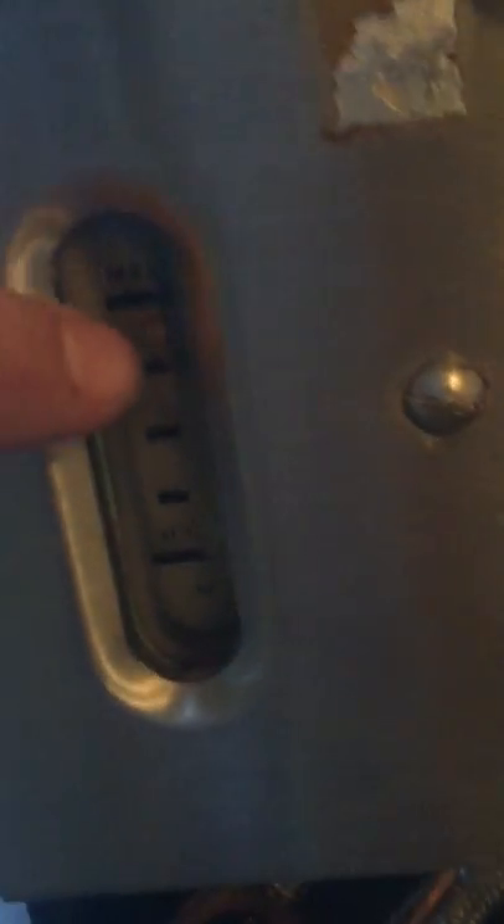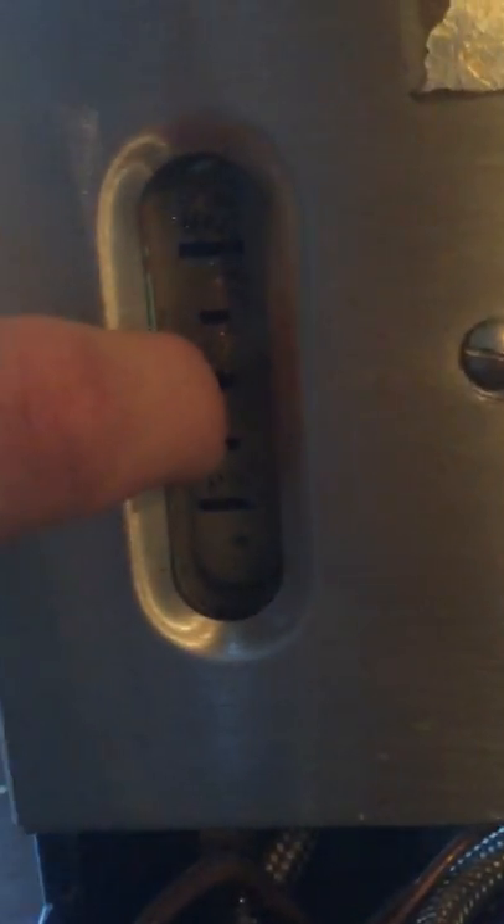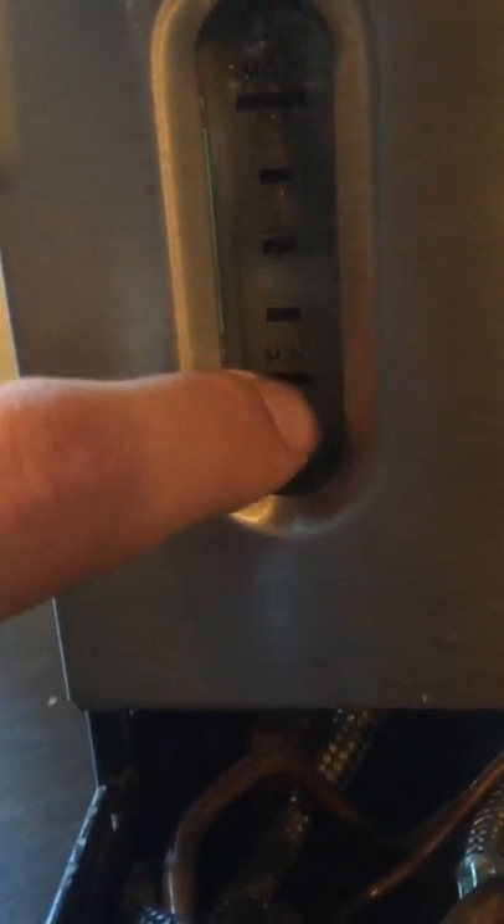That's the activation for the manual boiler fill. Here's the sight glass — you can see, kind of past the condensation, there's this brass rod right here. When the water contacts the brass rod, it stops the automatic boiler fill. You can adjust where this brass rod is and where it will start and stop filling.